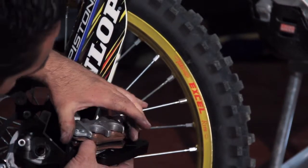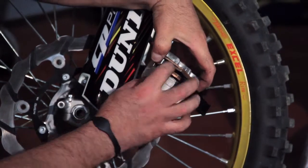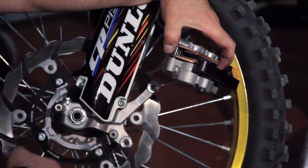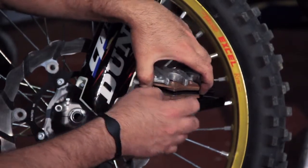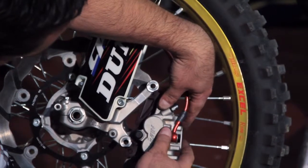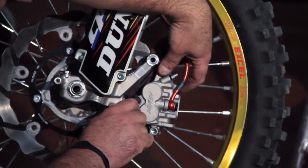You want to separate the brake pads a little bit, one from the other, so that you have enough space to slide the caliper back onto the rotor. We've already pushed the pistons down, so you're looking for a nice enough cavity. Simply slide the caliper back on, and make sure that you bolt everything up properly following the stock OEM specifications.